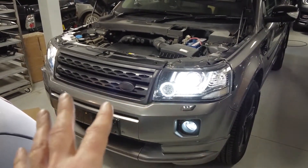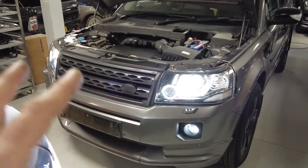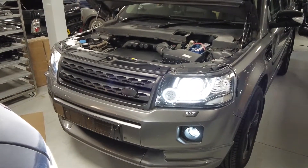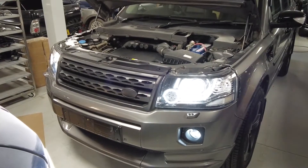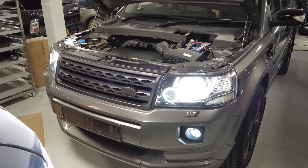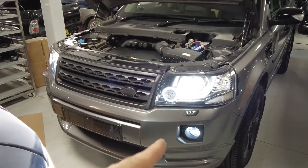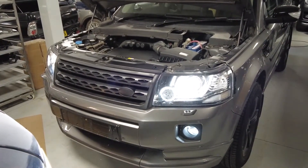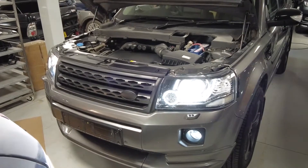Main beam is happy enough, no problem there. There's some current sensor in the body control module, and if the current doesn't match what the car is set to match, that's the problem you get. You can use the IID tool to change the car configuration from halogen to xenon and see how both respond.